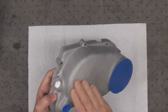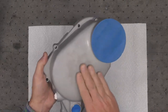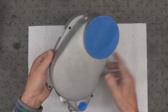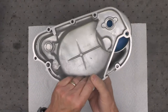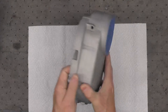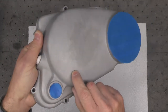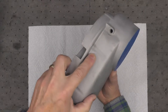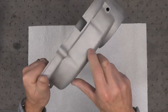After stripping the Simply Silver powder coating off this engine cover, I decided I am going to go ahead and hit it with glass beads in my media cabinet just to smooth off the surface. It's in pretty good shape — I've already got it masked off at the gasket surface to protect the inside of the cavity. I'll approach it from the outside and avoid the gasket surface just to smooth it out and give it some consistency. There's also a little divot right here, and a bigger flaw up on the top, so I'll go ahead and fill those nicks.